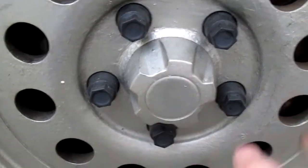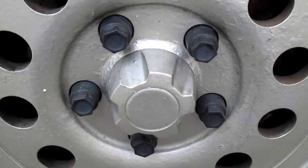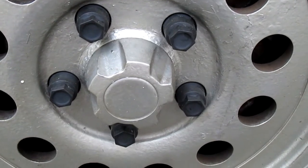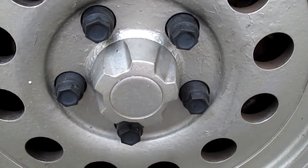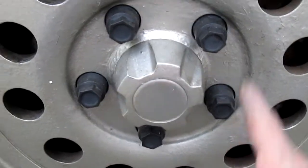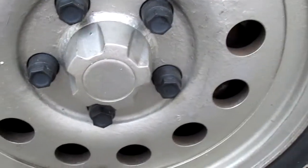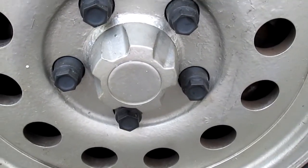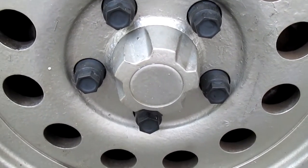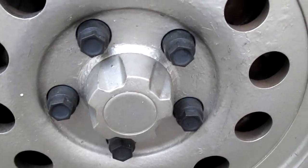Next year I'm just gonna take it all out, re-grease it and put it back again — I do them yearly now as preventive maintenance. I take them all out and make sure the caliper and stuff is working correctly. So if you do this, make sure to put the anti-seize in there — it costs next to nothing but it'll save you a lot of headaches later. That's about it on this video — I hope you find it useful.